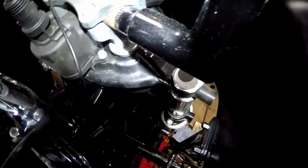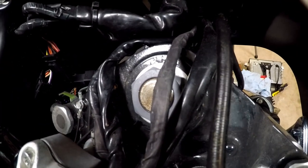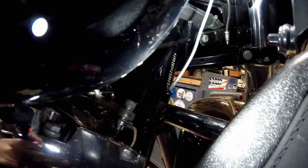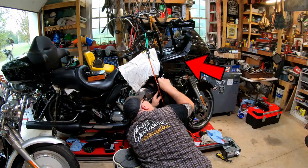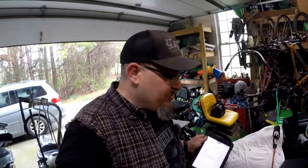There's your head nut — steering head nut — down here. Down here's your pinch bolt. The star adjuster nut is back over the handlebars, right underneath that nut there, so it's going to be under this area here. One way you can see it is if you turn the wheel and turn the handlebars all the way back. So we are going for that up there, and once we get it adjusted we retighten the neck nut and do the swing test again to see if we got it tighter. We're going to follow the manual — I have it downloaded as a PDF on my iPad.